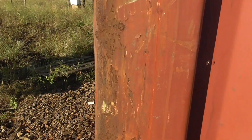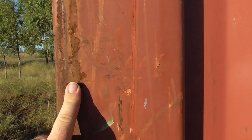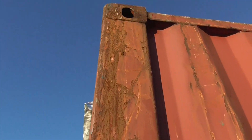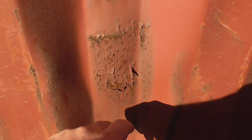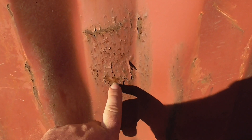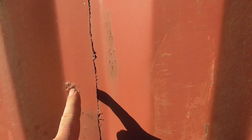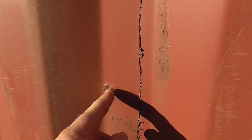Look for rust. Here that's just a bit of surface rust — that's nothing. They can just be given a quick clean up and painted. I haven't really seen any major rust. Here's another one to look for — you can see the paint starting to flake and a bit of rust starting underneath. So that's a spot to watch out for. These are only minor and can be cleaned up and dealt with.